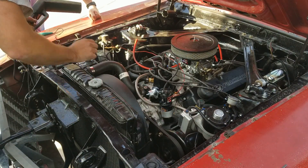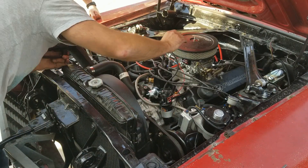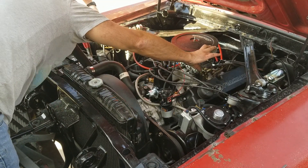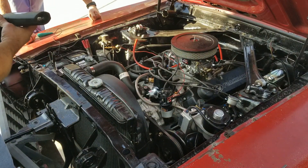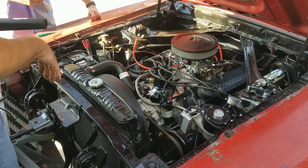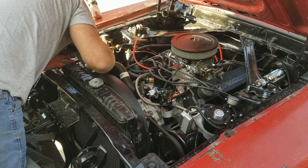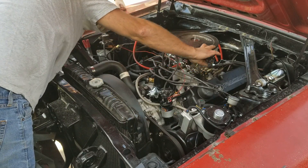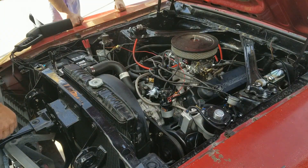Kind of curious to see what that does, running that high. You might have to turn down the mechanical. Having a spark that advanced — it may mean you want to move the valve timing again? No, the distributor has a mechanical advance built into it. And so this one will advance probably 25 degrees or so. You say it's a little high, and that'll make it high on the upper end. That's right. You want to make it not advance itself so much. Yeah, that hit 30, but I got 20 degrees retard in it. That's going up to 50. But it sounds good. It's time to take it out and see what she does.